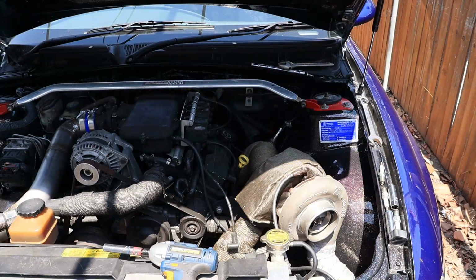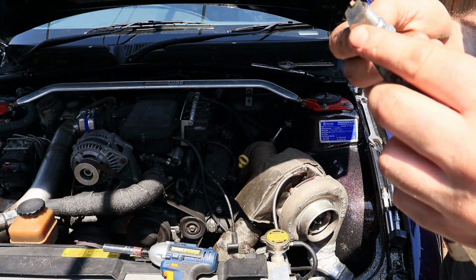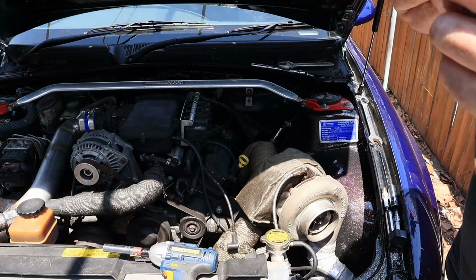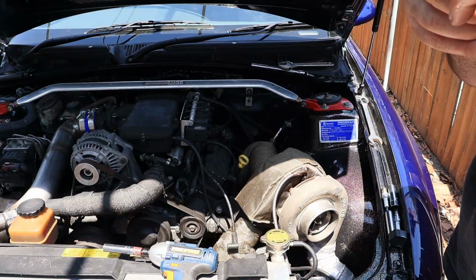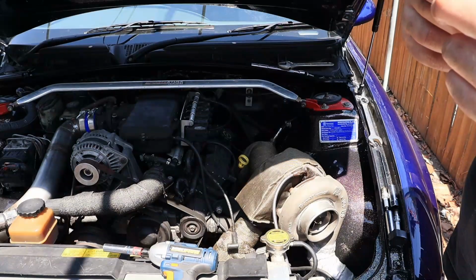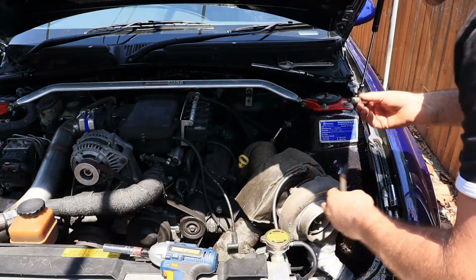Alright, just grab my feeler gauges. Alright, there we go, 0.5 mil. So I'm just going to gap these down to 0.5 mil. They don't have very far to go, so this one's pretty much there already after a couple of taps. Yep. Stick this guy back in.